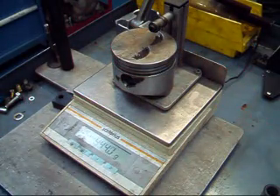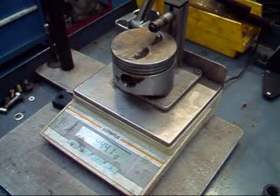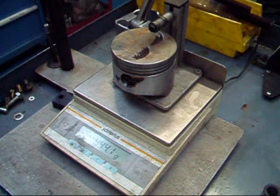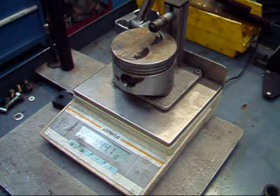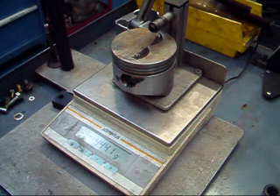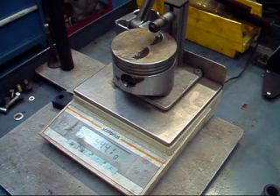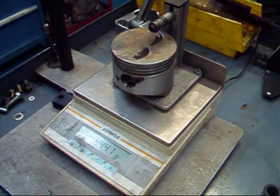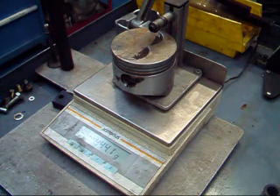For my previous weights, I found that the stock piston was about 444 grams and the JE weighed in about 377 grams. That's a 67 gram difference between the stock and the JE piston — or in other words, it's a 15% reduction. On the pins, we have a stock weight of 130.4 grams and the JE pin weighs in at 109.3 grams, which is about a 21.1 gram difference, or about 16%. All of these differences will play a big part in how this engine will rev.